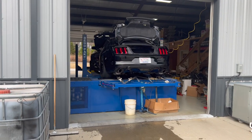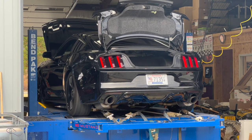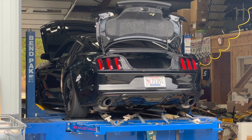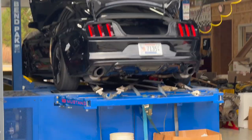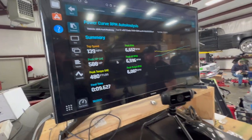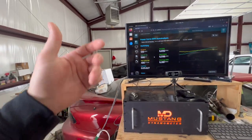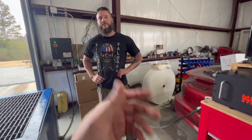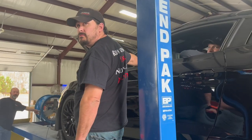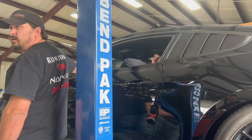Alright guys, second hit. I'm steering back a little bit — it's loud. Oh, knock — yeah, 588, so 480 torque. It's fuel. If we had like a boost juice or something it would fix it, but it pulled a degree and a half earlier. With no knock it would have been another 10-20 horsepower maybe. It's a healthy car though. A lot of times when these start pulling from the start they don't fully recover — they should let out and get back in. A degree and a half — without that, what do you think the numbers were? I would guess 718 to 720.